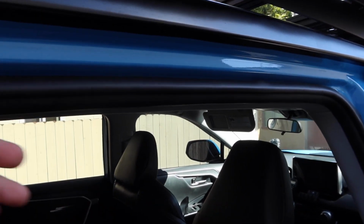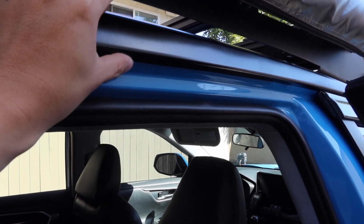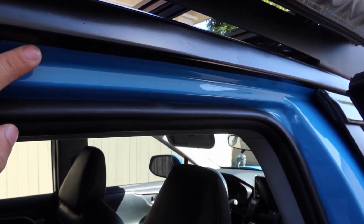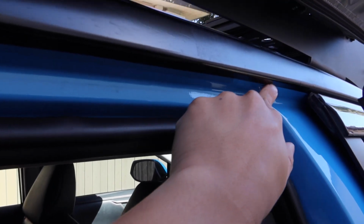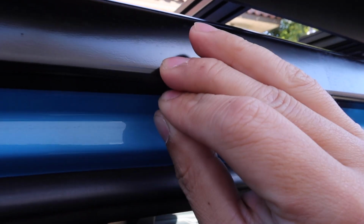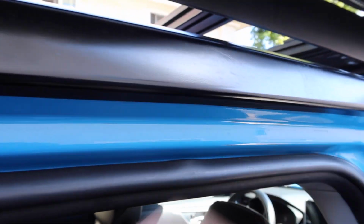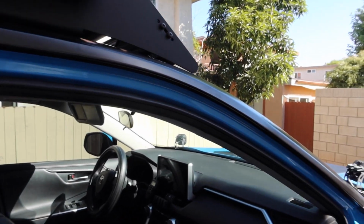Along in here, what I originally wanted to do was use some of the knifeless tape and line it up here. Ended up getting too far into the project to where I didn't really get time to apply it properly. I took a sharp blade and I just carefully ran it along here, using my finger to guide the edge, and held the blade nice and firm and steady, and just pulled it across this way like this, and then I was able to get a fairly clean line. As you can see, it's nice and tucked in there. Same with the front, all the way.